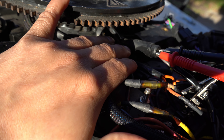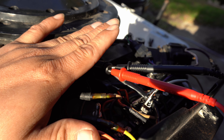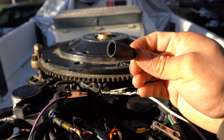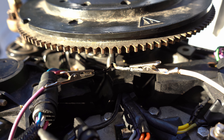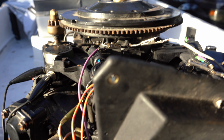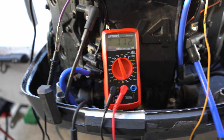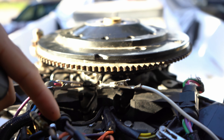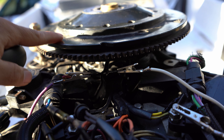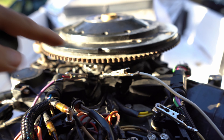The connected DVA value was 190 volts. Let's unhook the stator and test it by itself. I slipped the terminals out of the boot — just be careful not to mess them up. I got them hooked up to the DVA adapter. Testing the brown and brown-yellow wire disconnected — it went past 300 volts. So while connected it gives about 190 to 200 volts, and disconnected it exceeds 300. That is perfectly fine — the CDI technician confirmed the stator is good.